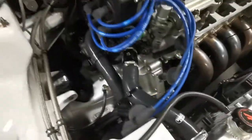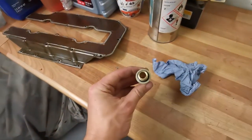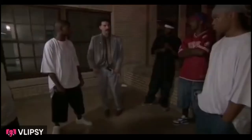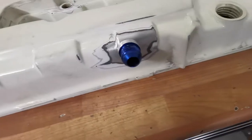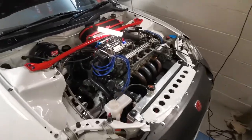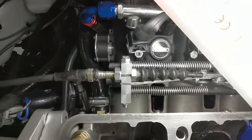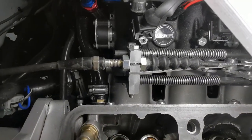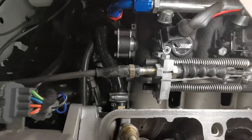Got the bung fitted with the new washer, and I've taken off the hose barb from the back. I just needed a new dowty washer for it and it can go back on now I've done the clearancing. As you can see, there's just a bit more room in that manifold so it's easier to get the Jubilee on and off and in a nicer position. With any luck that should seal up nice and tight.